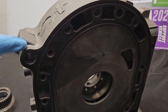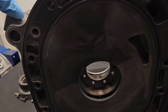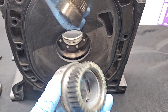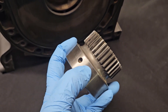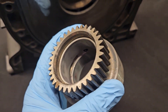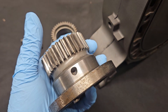Because this is an oil feed and oil gallery itself, the oil is coming down from the back of the motor into a channel that is actually feeding right here — you can see that little oil hole feeding the main bearing of the 20B. It's also interesting that the 20B main bearings have a slightly smaller orifice on their center bearings and run a three-window style bearing versus the main front and rear, which are a multi-hole and have a slightly bigger orifice.